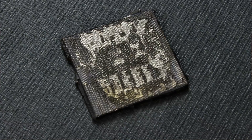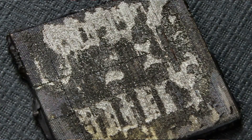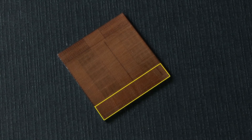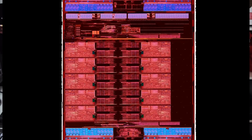Here you can see the die — this is actually the back side or top side of the die, depending on perspective. We can see the side of the die connected to the package, and zooming in we can see all those small connection points, like BGAs but very, very small, connecting the package to the die — there should be around 2011 connections, same as on the bottom side of the package. With a bit of imagination you can already estimate the position of the cores. There are lines going across the die separating specific areas: the uncore area, the memory controller, and in the middle the L3 cache. Comparing to a die picture released by Intel, you can see the middle area is the shared L3 cache surrounded by the individual cores, with the memory controller on the bottom and the uncore area on top.